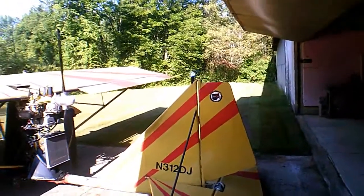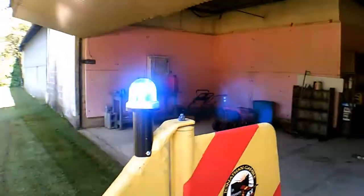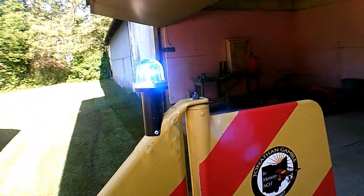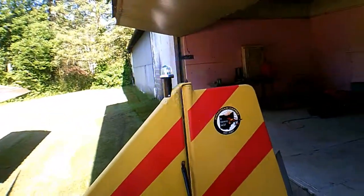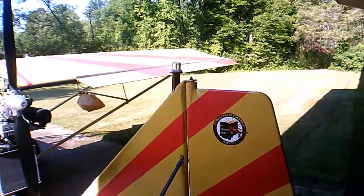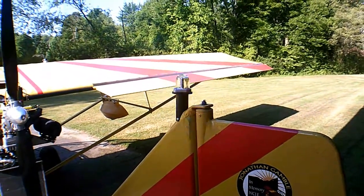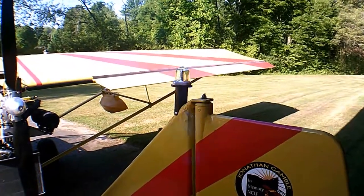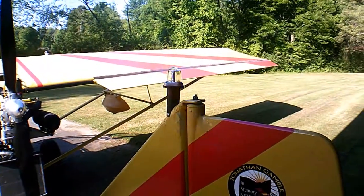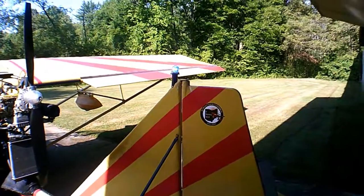I made a little modification here today. I put a beacon — this is an LED bulb inside here instead of that strobe. I don't know that it's brighter than the strobe, but they say they're more noticeable. It gives kind of a bluish light, and it doesn't take much power to run it. I can adjust the flash patterns — it's not just a steady flash, it blinks differently, and you can change that pattern. I could put an H1 halogen bulb in there too, which is really bright, but they say those aren't as noticeable as this, so I'm going to try this for a while and see how it works out.